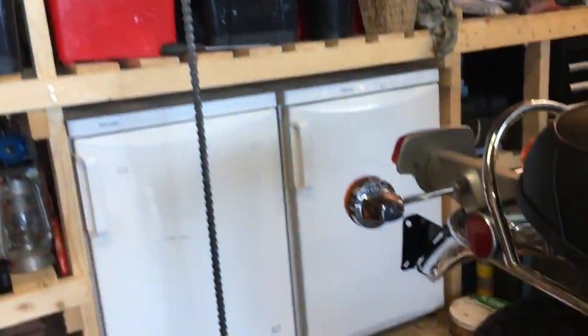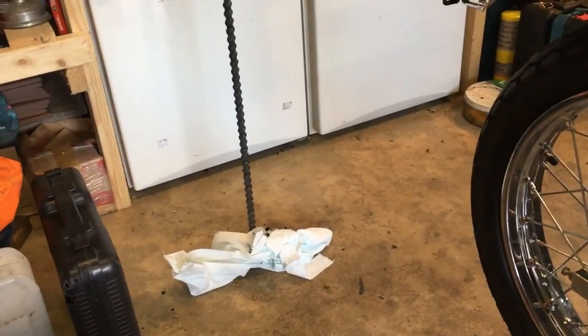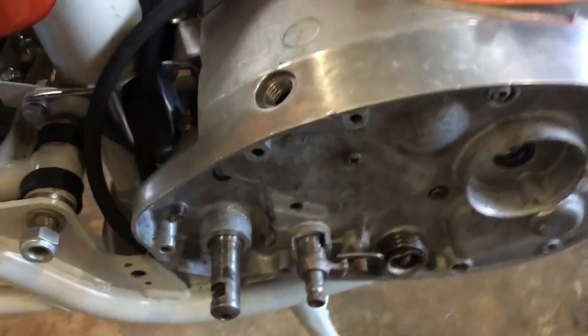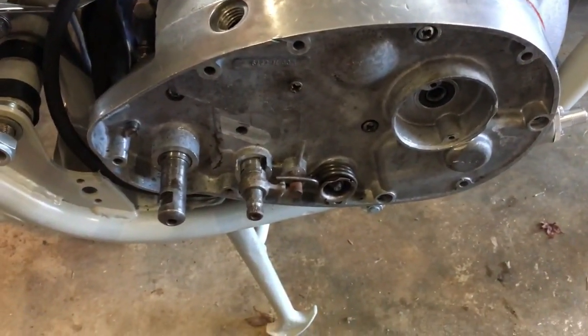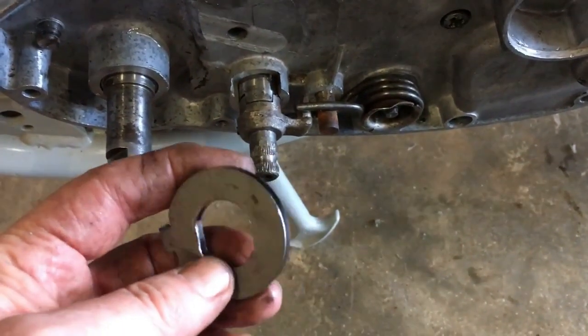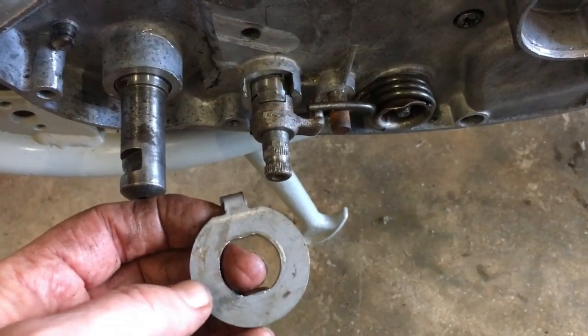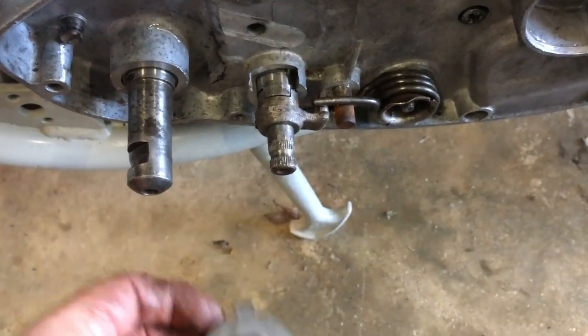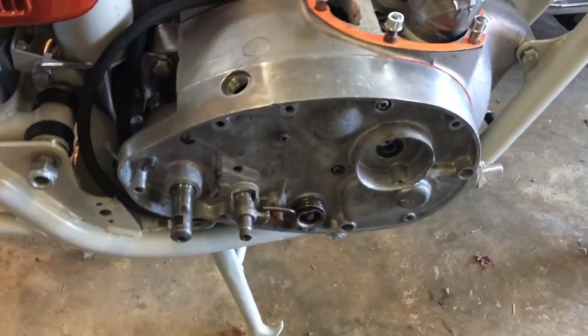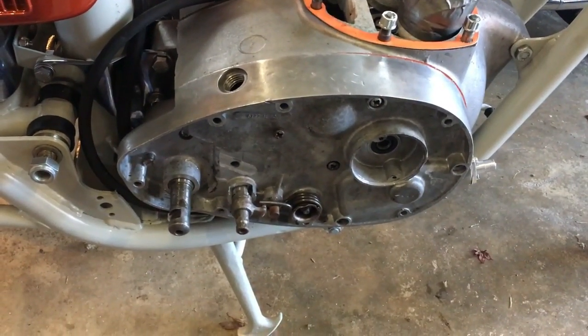Chain cooked and hanging up, just cooling down now — giving it a wipe down and it'll be ready to fit. But just before I move the bike across, now we've got the outer cover off, I thought I'd fit the kickstart return spring. I do have a new spring plate which arrived recently, however when trying to fit it with the original spring it broke, so that's another thing to order up. We'll leave that side for now and get the bike over to begin on the primary drive.